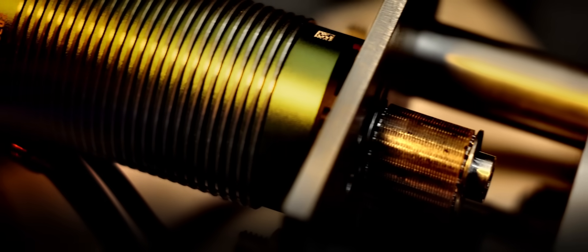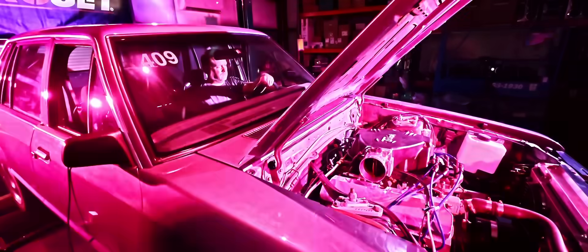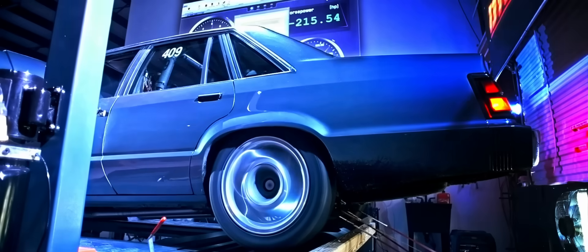The mounts, belts, and drives are all fairly easy to figure out. Also keep in mind that the LTD has a powerglide transmission, which means the horsepower numbers are going to appear a bit low compared to a modern automatic with a lockup converter or manual transmission. For the boosted numbers, you can easily add 100 rear-wheel horsepower and be somewhere in the ballpark. I found out literally three days before we shot the dyno test that Castle released some new parts which would take things up to another level — I'll get to those at the end of the video. For now, let's go set our naturally aspirated baseline.